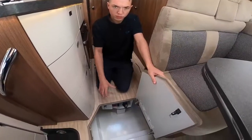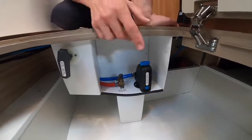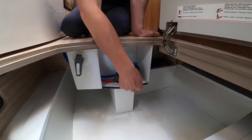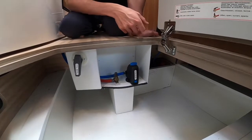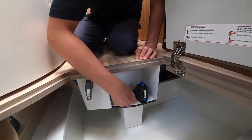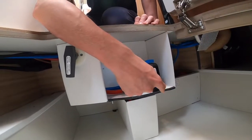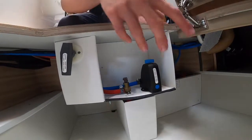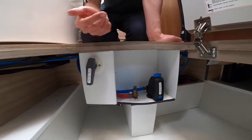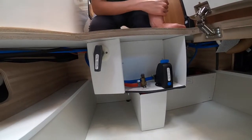Underneath the hatch of the double floor as you get into the vehicle, you've got three items. First is your boiler drain. This is what's known as a Truma anti-frost valve — at 3 degrees it'll automatically drop the water; the blue button pops out and 10 litres of water will drain out underneath the chassis. Should you want to isolate it yourself, turn the diamond from side to side to front to back. With the pump off, the button will pop out and it will drain all the water from the boiler. To stop it when reusing: turn the diamond back to side to side, push the button in, then pull water through the hot and cold taps — it'll cough and splutter until you get a free flow, then the boiler is full.